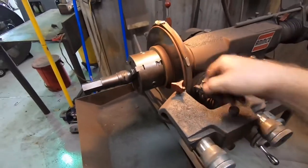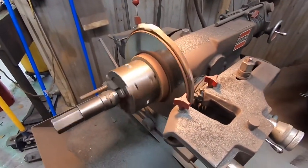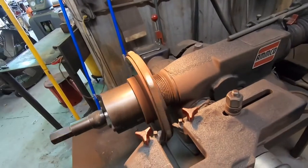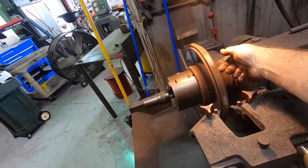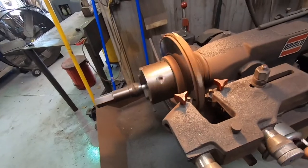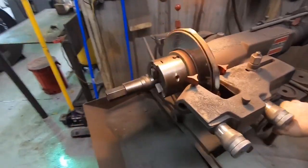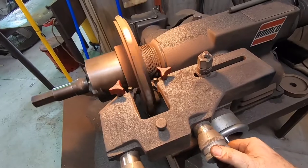Got to back off your blades — you don't want to run your blades in narrower than the size of the brake disc. I always run the bit until it just touches — that's the sweet spot. I want to take this lip off so that when you've turned the blades in further in the middle to set your depth, when it gets to the lip, it's going to jam up the machine because it'll be too much metal at one time. I try to take off about four to six thousandths at a time, depending on how badly the rotor's got a lip. Of course you have to measure the rotor and make sure it meets specifications.